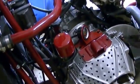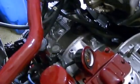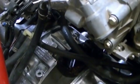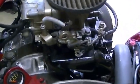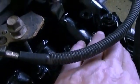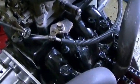And this last winter I took my other engine, totally rebuilt it. No big pieces, I just replaced all the consumables that are inside that engine. By the time I was done, it was about $1,075 for all the pieces that went into it. Of course, there's the 500 Ollie. Two vacuum gauges ordered. One for this nozzle here, the other one for this nozzle right here. That way I'll tune each side of the carb separately. Hopefully I can get them the same.